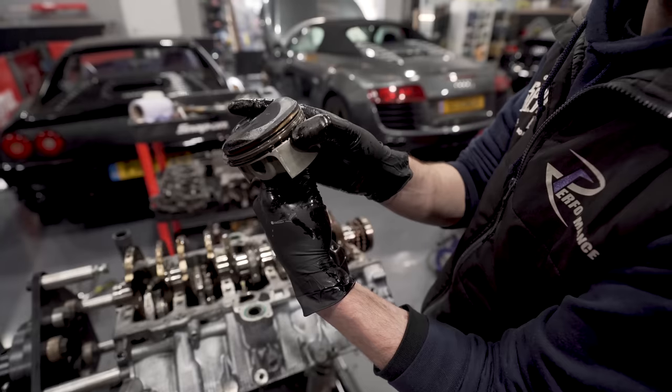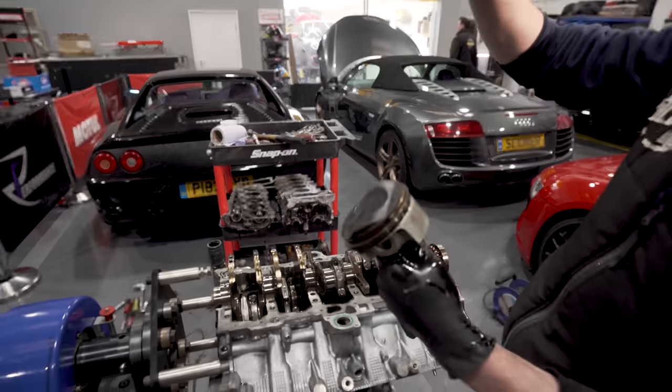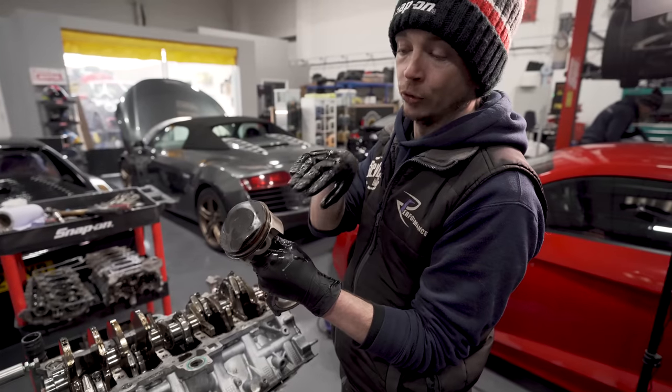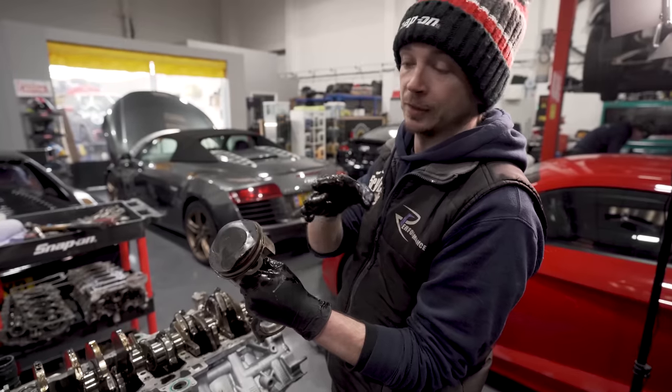Napier cut ring, second ring, which, as it comes down, sort of cuts in as well, so it's almost like a seven-shaped ring. Yep. So it's got a relief for the oil, because if the oil control ring's overwhelmed, it can jack the second ring and push it off.